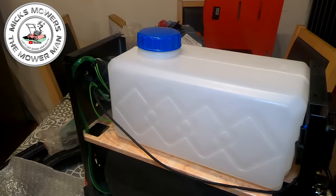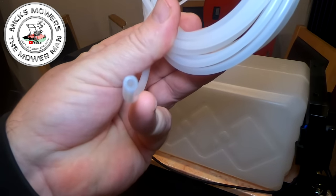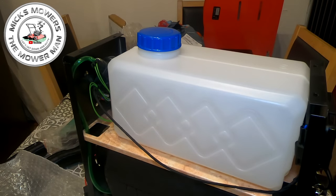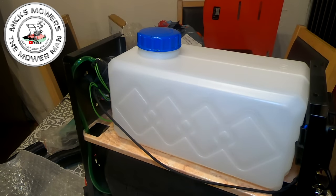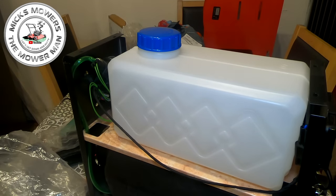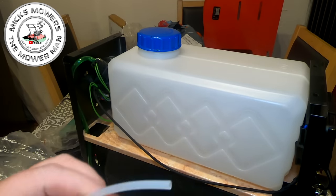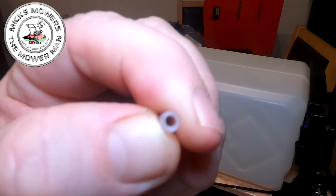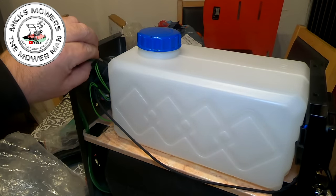If you go online, onto eBay, you can actually buy a kit — cost me nine quid. It's called a diesel fuel pump modification kit. In that kit you get about five meters of solid nylon 2mm inside diameter fuel line. You also get a proper metal filter designed for diesel fuels — not the paper kind. You get an abundance of little tiny stainless steel clips, and a load of fuel lines as well. By putting these solid fuel lines on, you reduce the amount of flex — these just don't move.